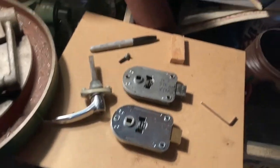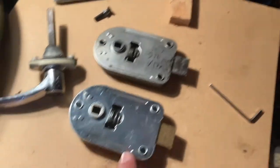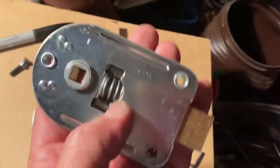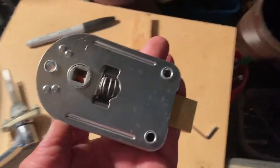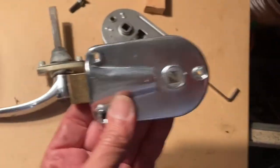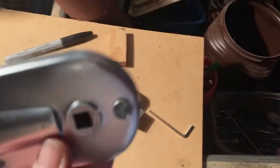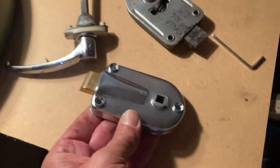So here we go with the real thing. First, make sure that it's the one you're going to use, because you are going to drill a hole in it. All we're going to do is drill a hole in this outer casing, and the drill bit will simply shove the spring out of the way. You don't have to go into the spring — it's not that delicate a process. The only thing we want to do is make sure you get this distance correct. This little mod has no effect on the latch or its function. I'm going to drill a corresponding hole in the back of the door, and that will make this installation possible, and even relatively easy.